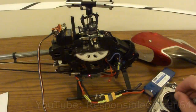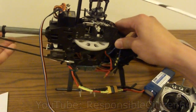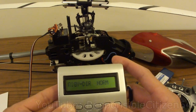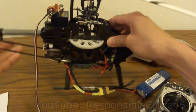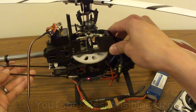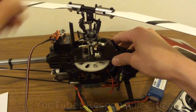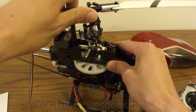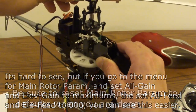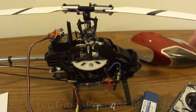If you've done your setup properly, when you boot up in flight mode you should have a level swash plate with all servo arms at 90 degrees more or less. Now in normal flight mode, we can work on getting the gyros in the correct orientation. You'll go into sensor settings and can reverse your rudder direction, aileron gyro direction, and elevator gyro direction. What you're looking for is to make sure that when you have an uncommanded external motion on the helicopter — I'm not touching the cyclic stick, just moving the helicopter frame — the swash plate moves against that motion to stabilize the helicopter. Notice when I kick the tail up, the back of the swash plate drops down to counteract that motion — that's the elevator gyro. Side to side is the aileron motion: when I turn the helicopter to the side, the other side of the swash plate drops down to counteract that. Basically as the helicopter is moved around by hand, you're checking that the swash plate moves in the correct direction to counteract those motions.